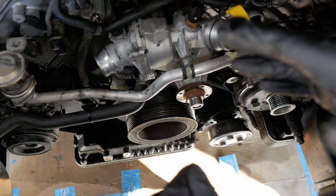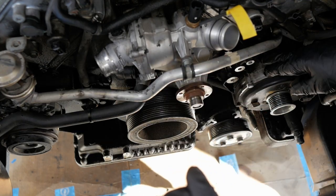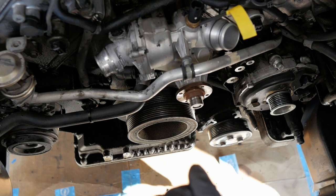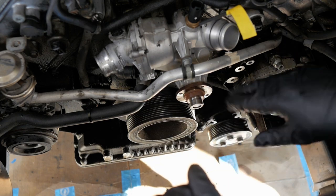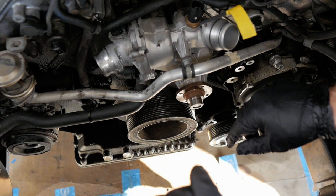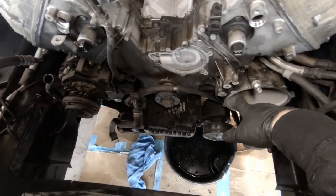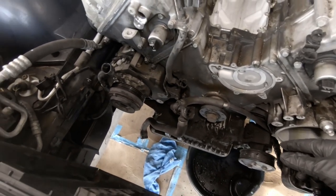For the sake of time, I'm not going to show removing everything off the front of the engine — the water pump, EGR pipe, EGR valve, various pipes, and the alternator. There are plenty of videos on those. Now we have most of the accessories, pulleys, and belts removed, including the water pump, harmonic balancer, and tensioners. We even removed the alternator along with the coolant hoses feeding its water-cooled housing — which is actually a water-cooled alternator, a bit of a pain but it all came off pretty quickly.